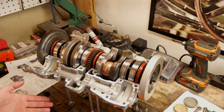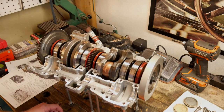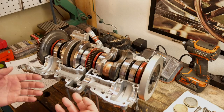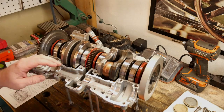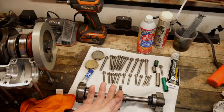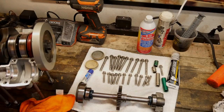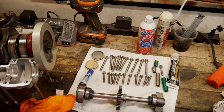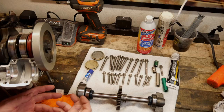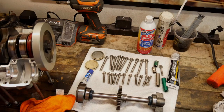The best thing to start is to make sure you have your manual and make sure you know the torque values, what it calls for, and make sure you're not forgetting anything like that. Then you want to go ahead and have your stuff set out like this. I've got all my stuff laid out, already have all the bolts ready to go, have our lock tight, we have our tools, have our torque wrench, and some chem tool for cleaning the case before we start putting the engine together.